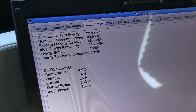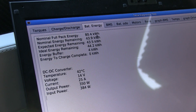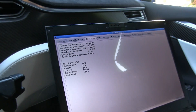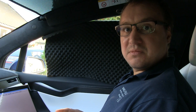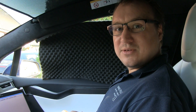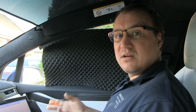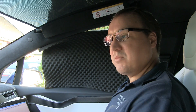We see this on cars that run long distances, short while, and a lot of supercharging. Tesla has its own way to balance the BMS. I won't go into the procedure because normally you never should do it, but I have to do it. It's nothing that common people need to do. It's actually not a very good thing to do because you charge it really low and let it stay, and then charge it high and let it stay — neither of those things are good for the battery, but it's good for the BMS and it helps you get a better value on your numbers.